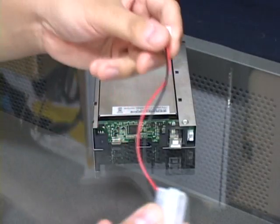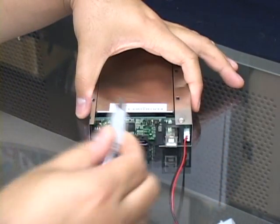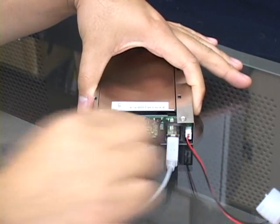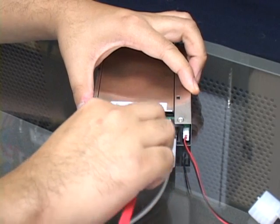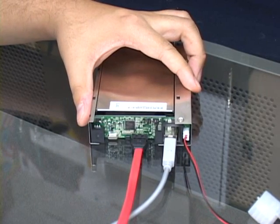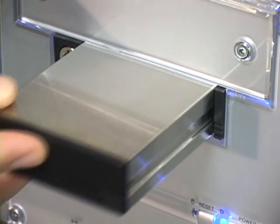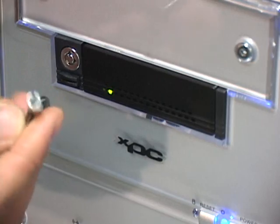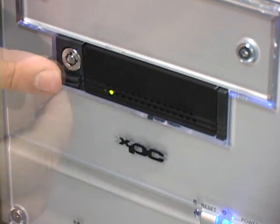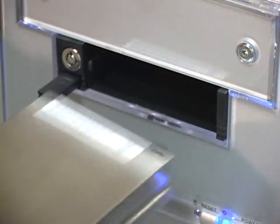You use the included power adapter to connect a standard Molex power cable to the back of the Dataport. You then have a variety of interface options: you can use the USB 2.0 port, or you can use a standard SATA cable to link it to your desktop or laptop. Both options give you hot-swap capabilities for your drives, assuming that you have a SATA controller that supports port multipliers. With the drive installed, simply slide in the carrier and lock it into place using the key. To eject the carrier, unlock the device and use the eject switch to remove the carrier. As everything is hot-swappable, there is no reboot needed.